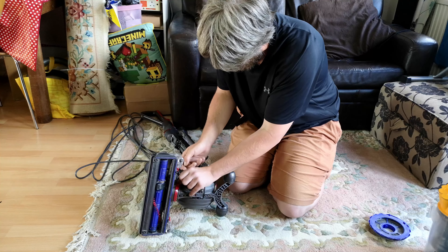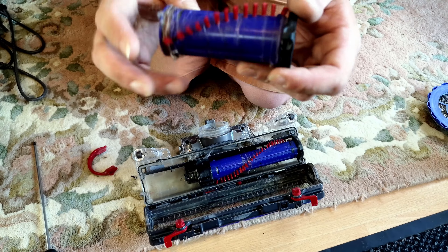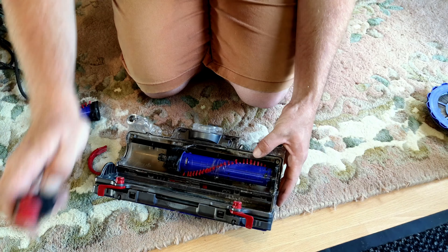If this comes out nicely — problem number one averted. The bearing melts off of the end cap, and if this and the cap are in two separate pieces when you take it out, trash it, it's no good. Actually that's pretty much seized up — that's probably why it just sounds terrible.